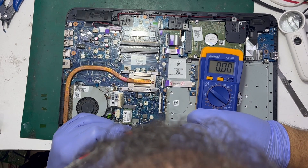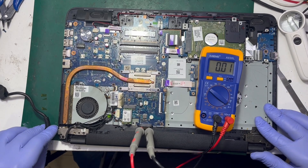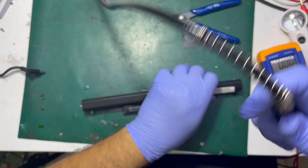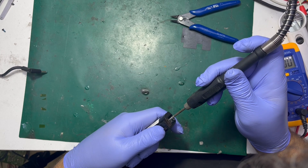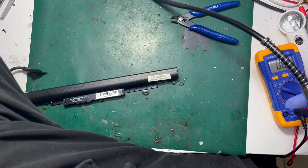As you can see, it's zero volts — it's like the battery does not exist. When I also plug the charger in, it comes to 11 volts then drops to zero. That condition means the BQ chip is trying to read the battery and get it some voltage, but since the battery is not drawing any current or charging, the BQ chip stops the charging process.